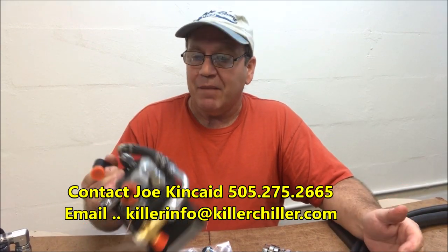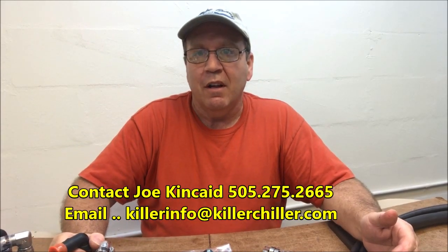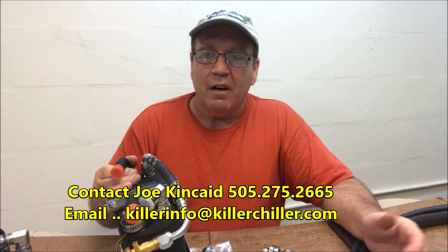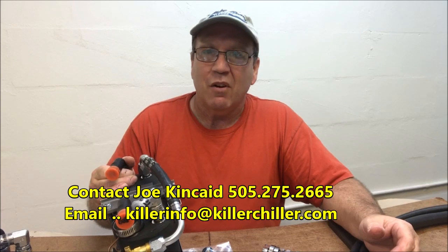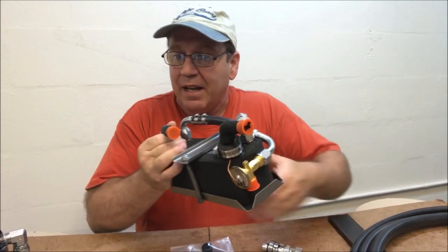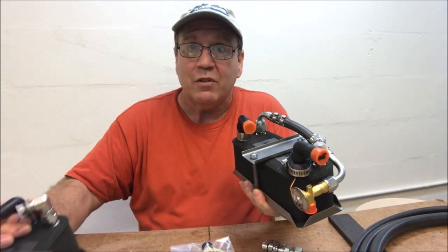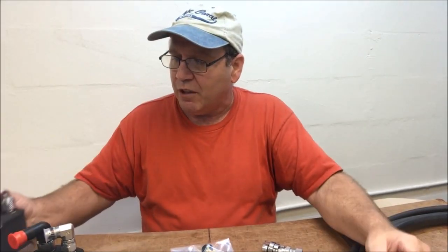And like I say, in my climate, I don't see it beneficial to do anything with this car before putting the Killer Chiller on it, because really, on an 80-degree day, the car runs pretty good. On a 90-degree day or above 85 degrees, the car doesn't run so good. So it doesn't really make any sense to make the investment to go to stage 2 and try to make more power when it's just getting too hot and it's not a good environment to make power. But with a kit like this, with 2 KC systems dropping my intercooler fluid as low as 30 degrees, we'll see over time how this thing really works out. That'll give me the basis of what I need in that car to then step up to stage 2, bring it for some tuning, and really try to make some power.